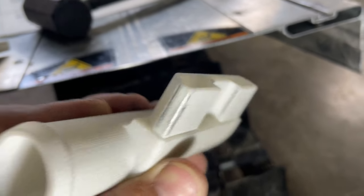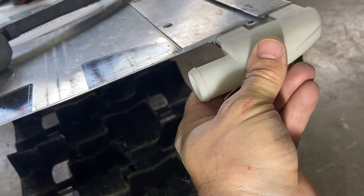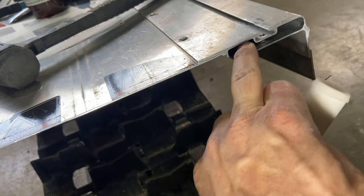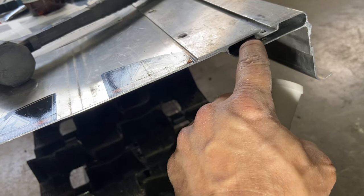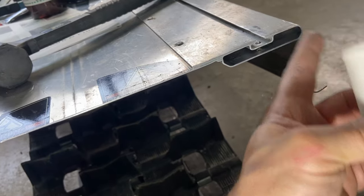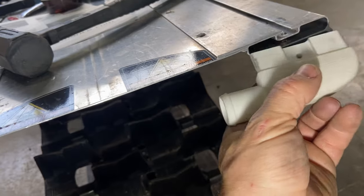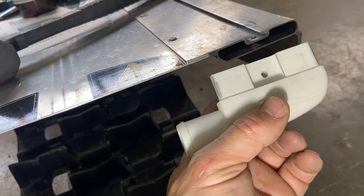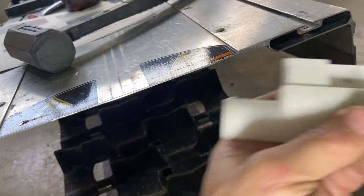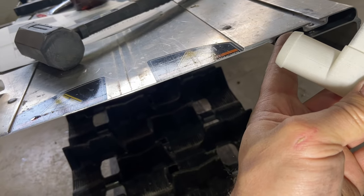So you can see a little bit there too, because it's tight on that end right there as it comes in. So definitely a snug fit. And I've double, triple checked. I have good clearance here. There's no lip or edge on here. So it's not that I've failed to get this properly cleaned up. It's just the difference in these two pieces here. So the rivet holes are in. I've double checked again that there's no burrs from having drilled these rivet holes, because you have to drill them after you've inserted these, and you're not supposed to insert these until you've cleaned this with rubbing alcohol.